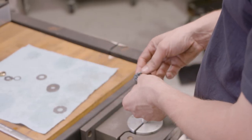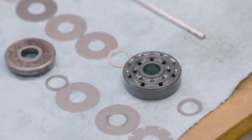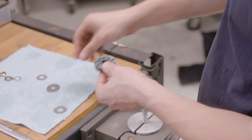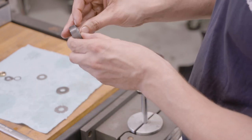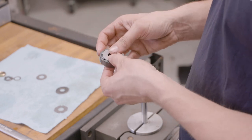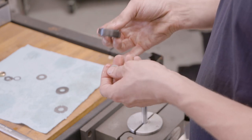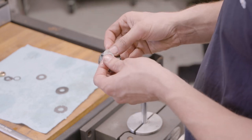This is actually a digressive piston. We have a 0.5mm hub-to-seat height difference, so we can actually preload the disc stack. Before any oil can pass via the disc, it takes a certain amount of force to break it away. A lot of earlier technologies ran a linear piston, and a linear piston still has a place in some motorsport applications, but for us we'll use a digressive 95% of the time.